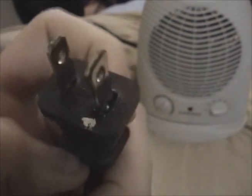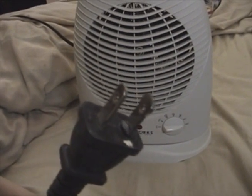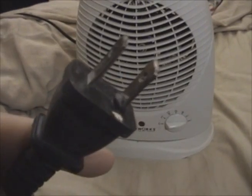She wants it thrown away and she also threw away the extension cord. You can see the plastic's kind of just really melted away and it bubbled up on the other side here. Maybe the heating coil's partially shorted out and it's drawing more than 15 amps on the maximum heat setting, although I'd hoped the breaker would go off in that case. The extension cord was a dollar store one - I've seen some pretty crappy ones. Maybe there was a resistive connection between the plug and the extension cord, which would obviously make it heat up.